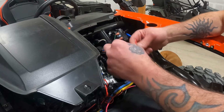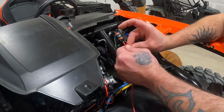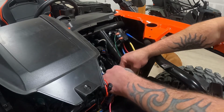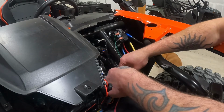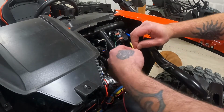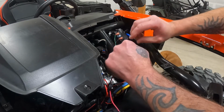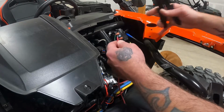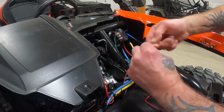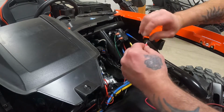But I'm gonna roll that up. I'll trim off a little bit of the insulation on this wiring here. Then I'll get those tied together and put on a new connector, and it should plug right in. And these are gonna be insulated connectors. And I feel like that's superior to just adding one of those splicers that don't appear to be insulated at all. The exposed wiring is damn near identical in length.